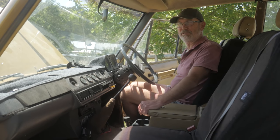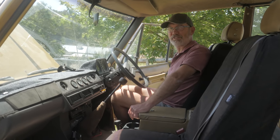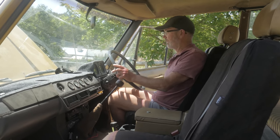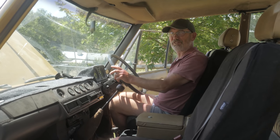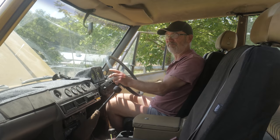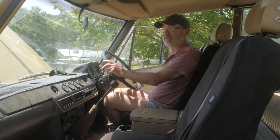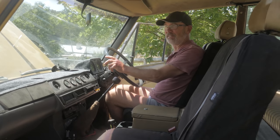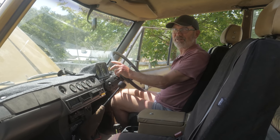One of the other problems I had just recently was the car drifting when cornering — it was oversteering quite a lot. So I got home and moved the steering wheel while looking at what the wheels were doing. The wheels were doing nothing but the whole body of the car was moving sideways, which is a very odd thing to see. I quickly diagnosed completely worn-out panhard rod bushes, which I've replaced with new bushes, and now the vehicle handles very well. For a car that's built in 1982, it gives a very comfortable ride and corners well — although without anti-sway bars it does tend to have a fair amount of body roll, but one soon gets quite used to that.